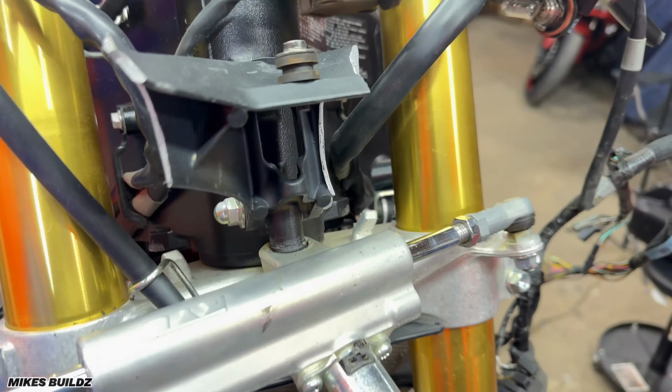Now I'm gonna remove the coolant reservoir. And we have that out and the radiator fan. Now we have the fan out. All right, guys, and just like that, we can see what I presume is the cause of the leak over here, because the blue coolant is clearly visible in this area on the other side, and this is caused by the coolant fan being pushed in here. Since overall the radiator appears to be in really good condition, I'm going to attempt to have that repaired. If it's successful, good. If it isn't, then I'll go for a replacement one.